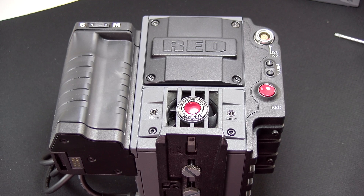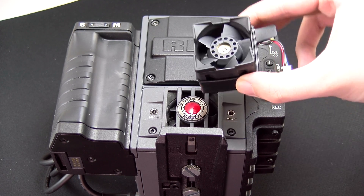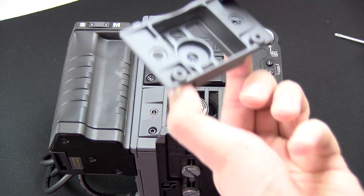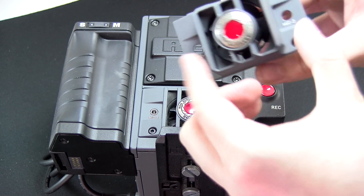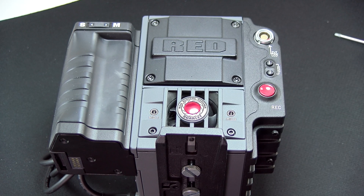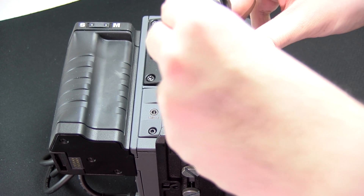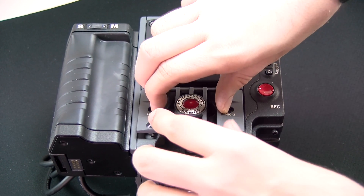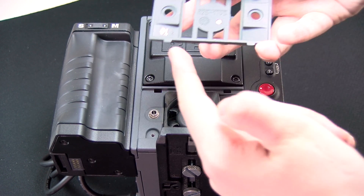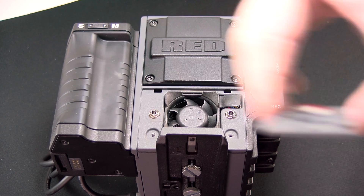Now let's move on to the front. The way these fans work is that there are actually two pieces: we have our fan itself, which is the unit that's going to be replaced, and then we have our front plate — they just go together just like that. RED's construction is awesome — this is not plastic, that is metal. The idea is the same: you're just going to remove these two screws, pull off the front plate, and then pull out our fan. Now that we've got that removed, we can just pull up and out. There are two little teeth on this one, so you'll make sure you install the new one that way.